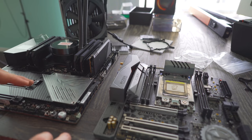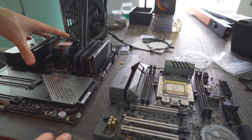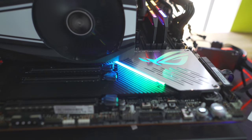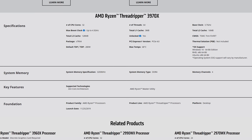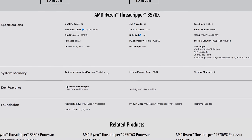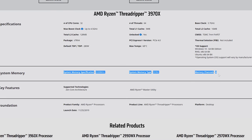Welcome back to Tech Yes City. We've got the two motherboards here side by side, and this TRX40 chipset is ready to go for the upcoming review. It's codenamed STRX4, as opposed to the X399 which uses TR4. On the CPU side we still have quad channel memory support, just like X399, but they've upped it to 3200 MHz official support, even though they've included a 3600 MHz CL16 kit of memory.